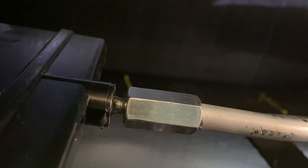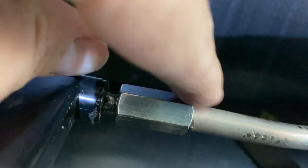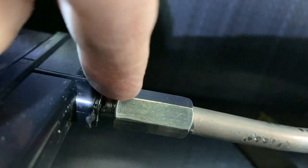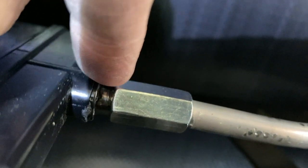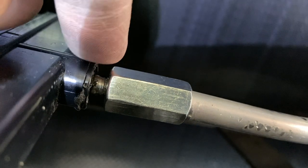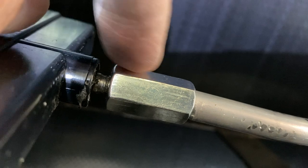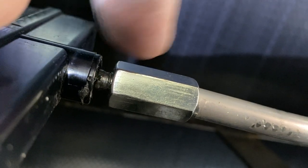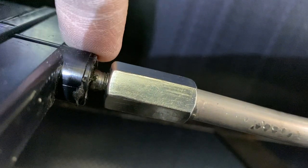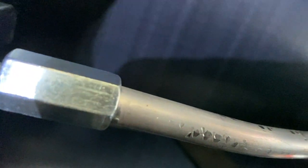All right, here's the gray tank valve. I learned that I took this coupling nut off and I actually thread the coupling nut onto the valve first. And then there's enough bind in the valve threads that when I turn the coupling nut, the valve stem just turns the way it's supposed to. And so I can thread this onto the aluminum.